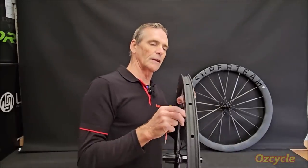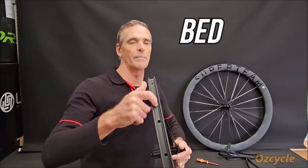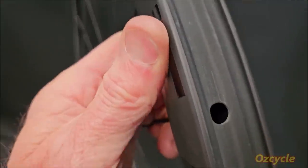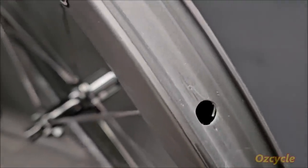With one of the rim tapes off, we can have a look at the rim bed — the part of the rim where the holes are. What we see here is typical drilling after moulding, which is pretty much the only way to put holes in a rim, with a little shard sticking out on only one spoke hole — no problem. Looking inside the rims with an endoscope: the nipple length is correct, not too long and not too short. There are no washers under the nipple to help spread the load on the rim — if the rim is too thin at this point, after a while the nipple can break through the carbon fibre, worth noting.